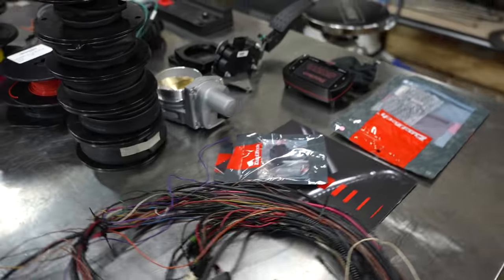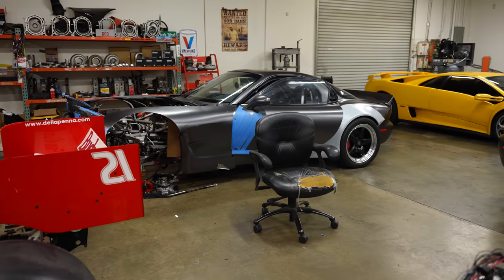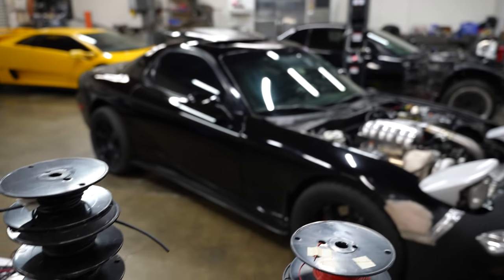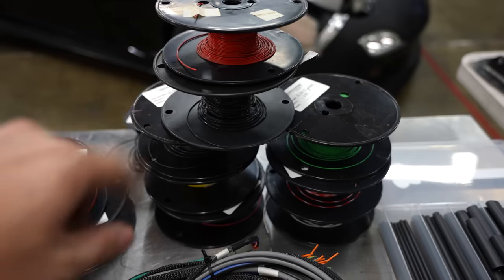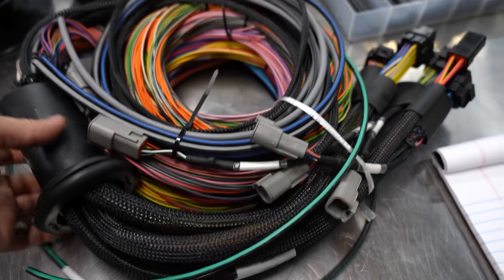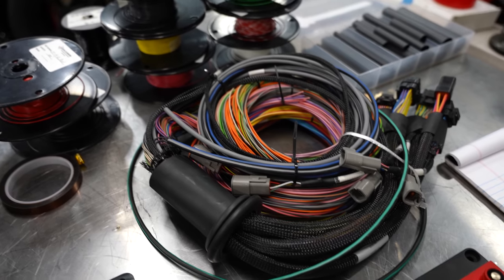This big harness right here is called a flying lead — this one came from Haltech. I've been using Adaptronic, which Haltech bought out, and made amazing horsepower on that car. I've also been using FuelTech on the three rotor with great success. Both companies offer this type of flying lead harness — it would be like a level 2.5. It's meant to be something you do yourself. I would recommend if you're ever going to build something as insane as a four rotor, start making a couple of these flying lead harnesses first because you'll learn so much in each step and add tricks to your toolbox.